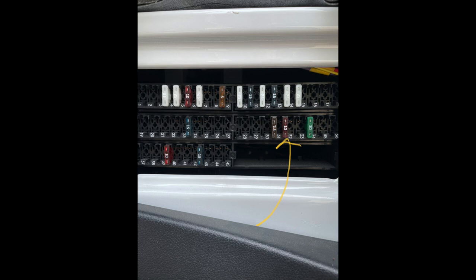One important update to this: a very important step is that you also need to remove a fuse. The fuse for this area is located under the driver's seat on the outside door facing the outside door, and it's fuse number 32. We've been told by two different Mercedes Sprinter dealers and technicians that when you do disconnect, you need to remove this fuse so that the auxiliary battery doesn't continuously draw energy from the main battery and drain it. So that is one really important step — remove fuse number 32.